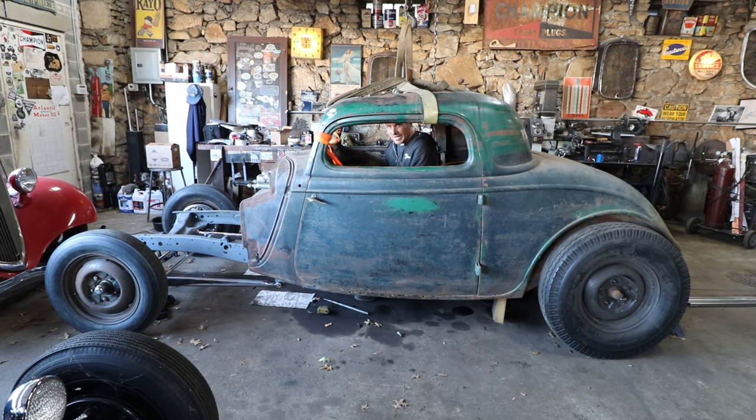That's where he ran into the problem on that. He always wants to staple and wrap and do all this stuff, so he wants wood. And I'm like, well, you've got to have like 3/4 inch plywood to do that, and that causes an issue. So whatever he did on that seat, I like that he put the convertible top underlaying material that's stretchy. So when you sit in that thing, it actually sinks down in. He cut holes in the wood where your rear is in the seat, so you actually sink down into that plywood with the foam. That worked out pretty nicely.